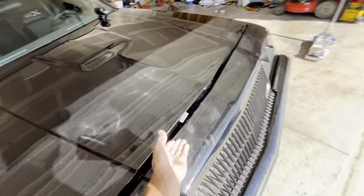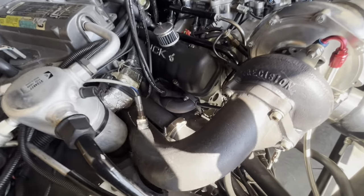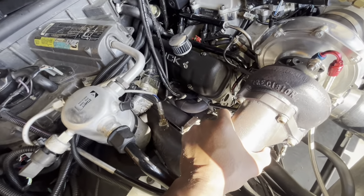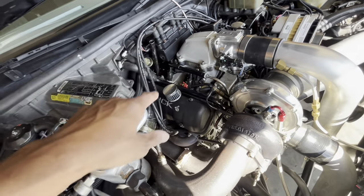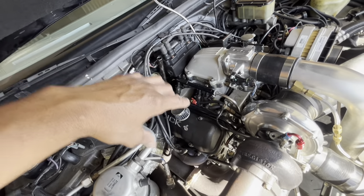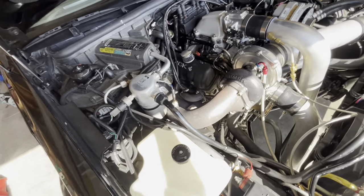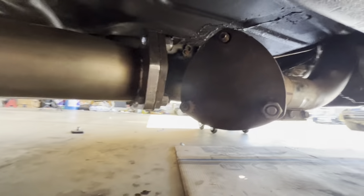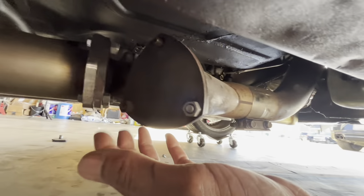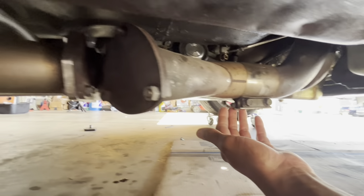So let's get started. I think the first thing I'm going to do is remove this downpipe to get to the headers and stuff. Then I got to do the TA bolts on the top part, leave the bottom ones, and then the drive shaft. So the first thing I'm going to do is take my downpipes off. I mean, not the header, but the downpipes — I got to take this pipe right here off. Let me go ahead and get that started. I got the tools and everything I'm going to need to just take this pipe off.